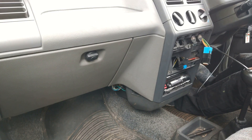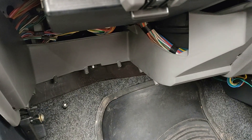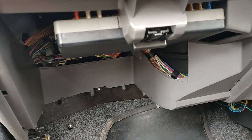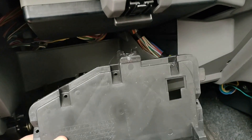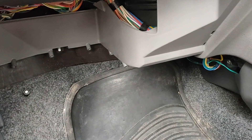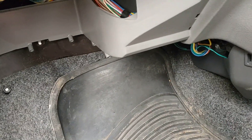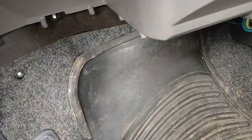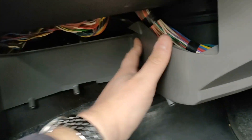We've got a nice clean test. The next job is to figure out how to get it through the chassis so we can wire it neatly. I've taken the glove box off before in previous videos where we looked at removing bits of dash to get to the steering column, so you can look at that. Basically we need to take all the screws out of this plate here which sits just below the glove box, then take off a bolt at the back which just holds the back plate onto the chassis, and then rather than remove the screw here, just loosen it off so that it can just come down.